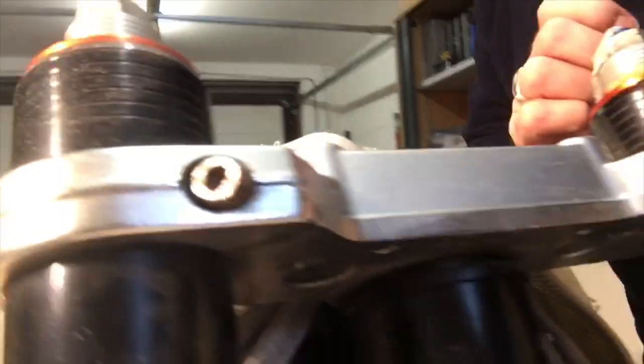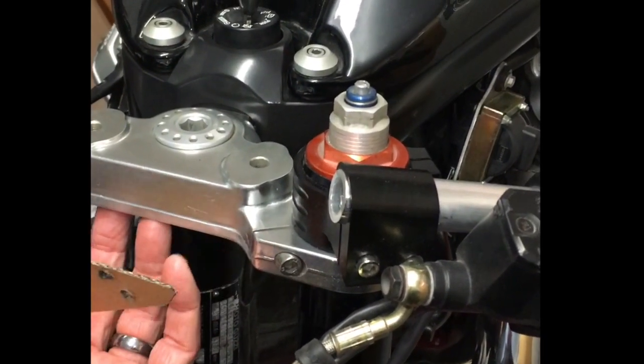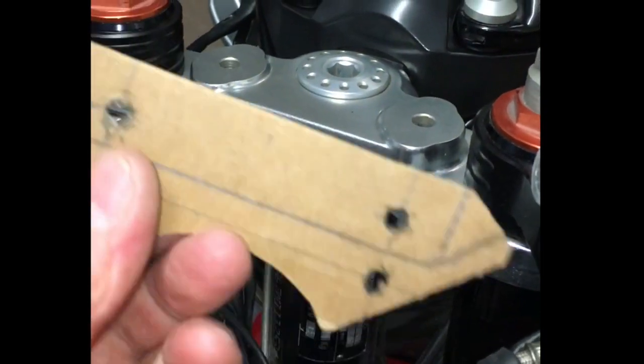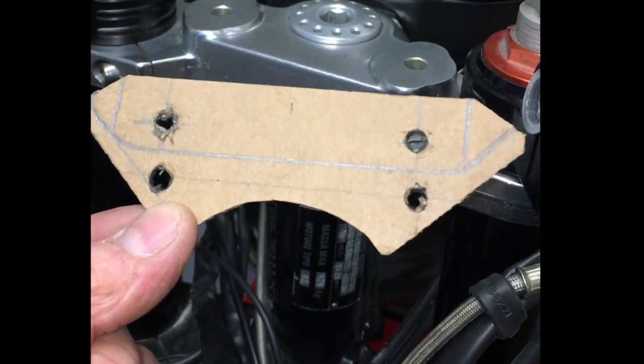Something really surprised me then - I thought this was going to be really tough to take off the clip-ons, but I'm generally really pleased with how that came out. It came out really nice and clean. I'm replacing it with a little template I've made up here, which bolts into two threaded blind holes there. So let's cut this out of two millimetre mild steel and then paint it up.